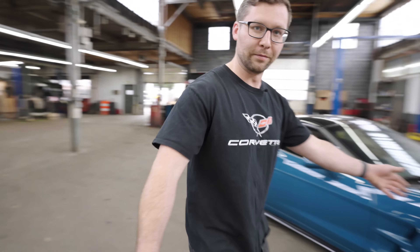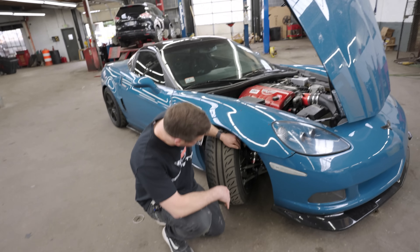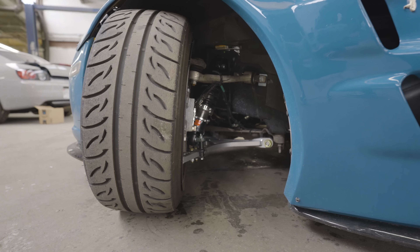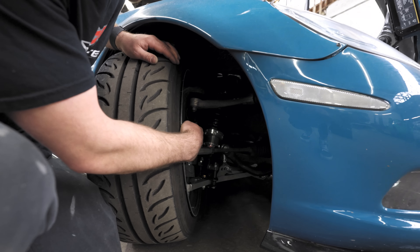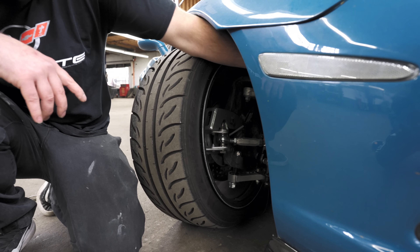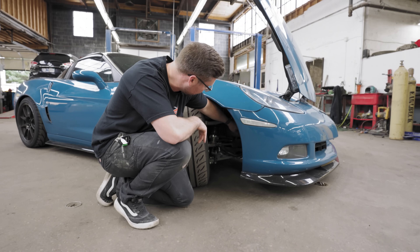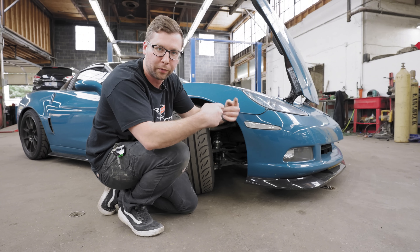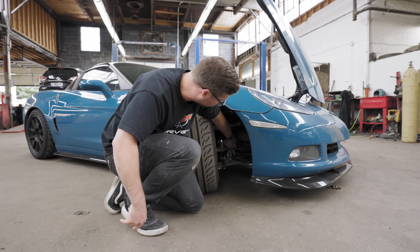Come take a look at the beautiful silvers — super low coilovers, FDF lower control arm, and back here you'll see the FDF mild mantis. I did have to shim the upper control arm to get some camber out of it because the camber is all the way drawn in at the bottom. I bought some random aftermarket sway bar end links that can bolt through both ways, because stock it's one thread this way, one thread this way, and I needed both threads to go through the same way.